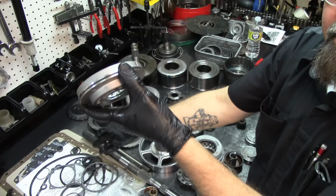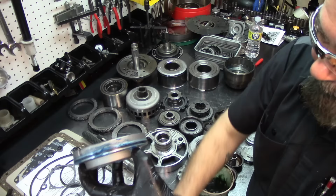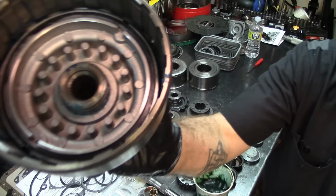All right. So let's go ahead and lubricate this piston and our lathe cut seals. I know I got you on the wrong side, but it's all right. And this, we just push down on it. There we go. So we just push the piston down in it.